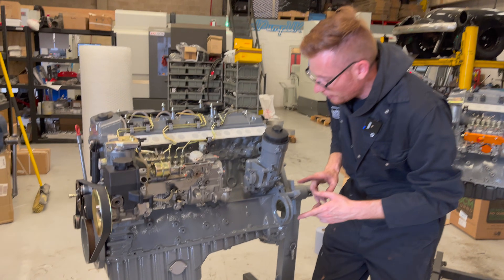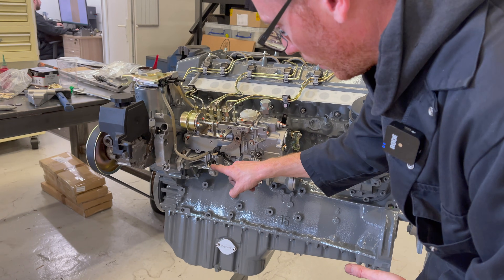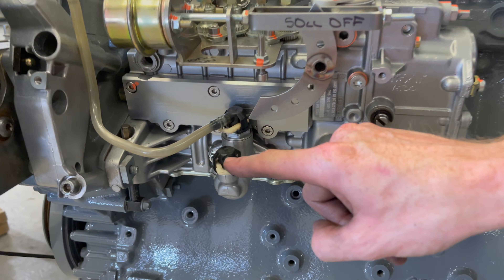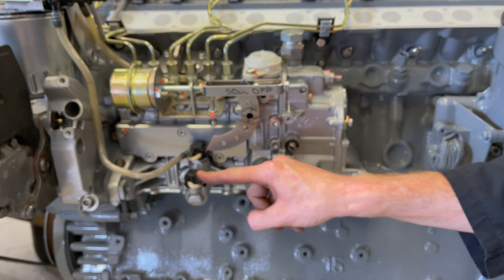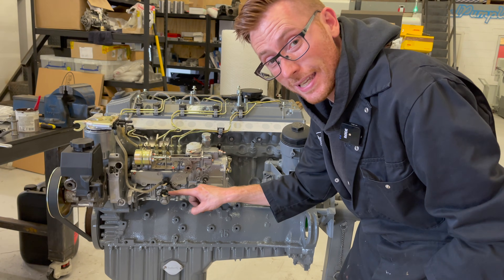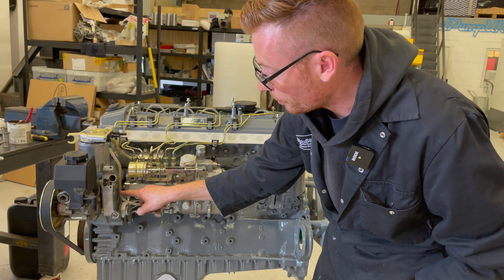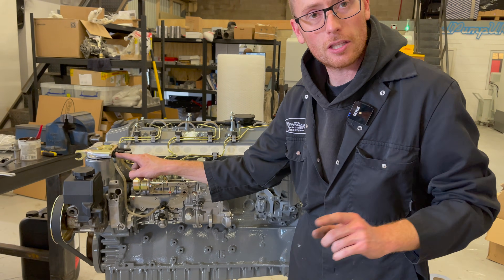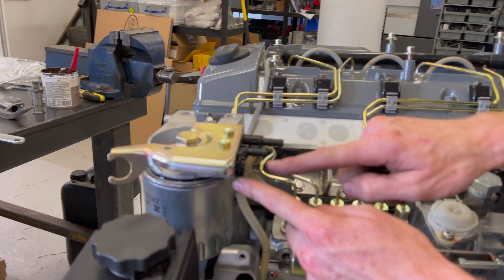So, in from the fuel tank — imagine the fuel tank is here. It's going to come in and go straight to this lift pump here, going in the lift pump. This is a vacuum point; it's the only vacuum point left on this entire system. That is the only place where air can be pulled on this whole system. It's going to get sucked in there, and then diesel is going to get pushed up out of this pipe. This is the original EDC pipe, so you don't have to cut anything or make anything. It goes up and then into the filter head on the far left part — that's the inlet.